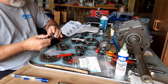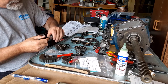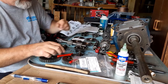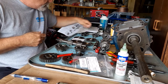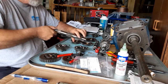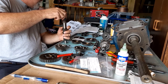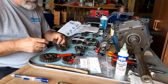All I'm doing is selecting different positions for the washer and then sliding it back and forth just to distribute the pre-lube I put on there. So that's on. There's my old circlip — let's get a fresh one out and put it in the discard pile. I'll go ahead and put the new one on and trade these out.